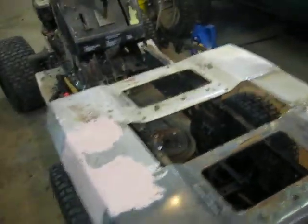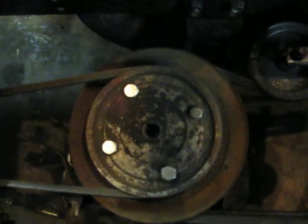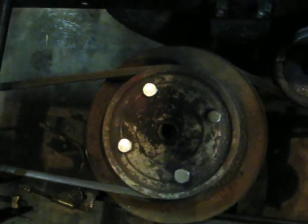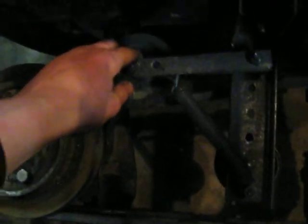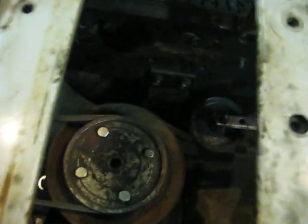I had to use two separate frames to extend it — it's been extended about three feet. We've got nine inch pulleys on here to connect the transmissions, and there's a six or seven inch with four bolts in it for the motor. What's going between these two here is just a belt — it's a deck belt off of an MTD. It's on a spring; you can see the spring right here, it's got tension on this so that the belt is real tight. I made that big bracket right there — I got a lot done, that's just for keeping the two rears set up good.